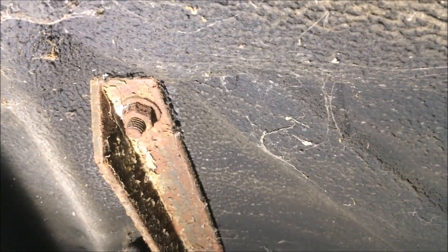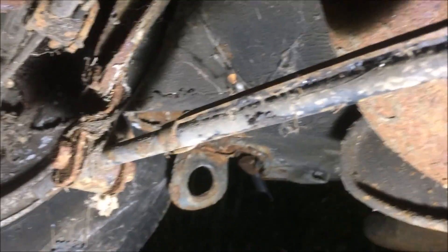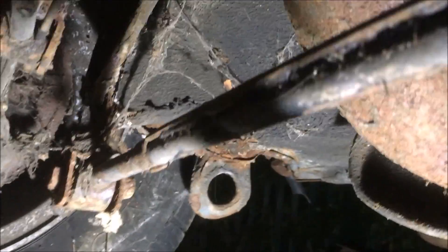It isn't as bad as I first thought. The tow bar area — although the floor is deformed it hasn't actually rusted as much as you can see. We have a big hole here and some frilliness along there, so all of that will need to be chopped out. But the good news is that where the Watts linkage goes — all the way across there's another mounting on that side — most of that looks good. The actual Watts linkage mountings are good; the towing eye bracket's gone as they most often do, but it's no big deal.